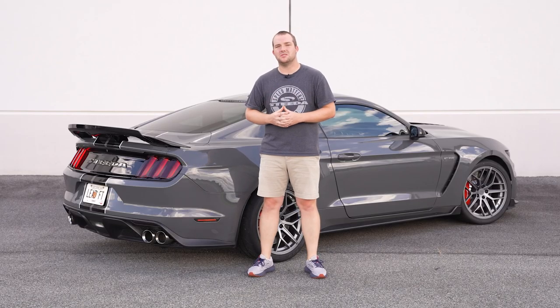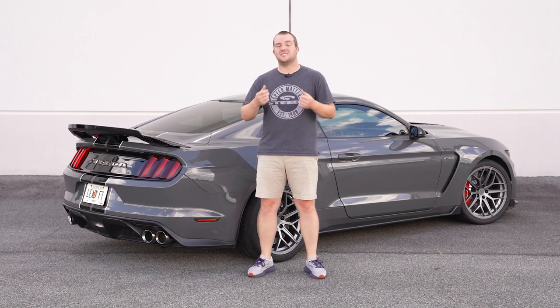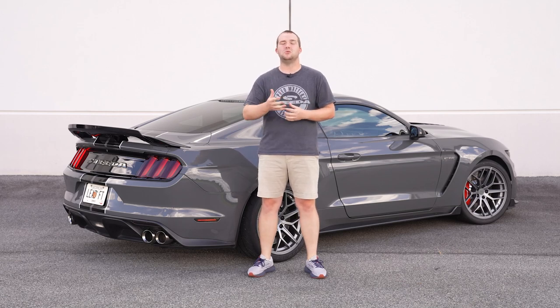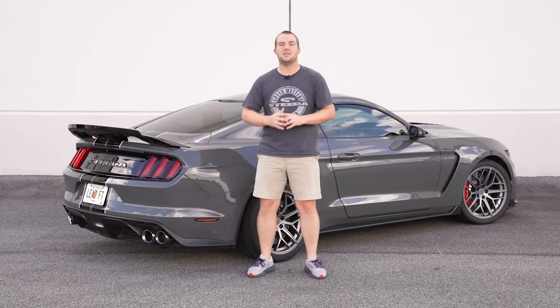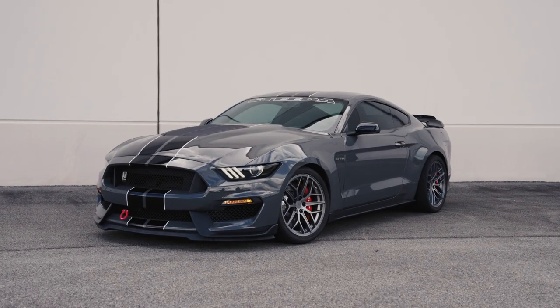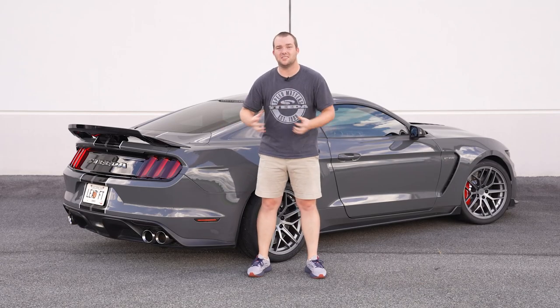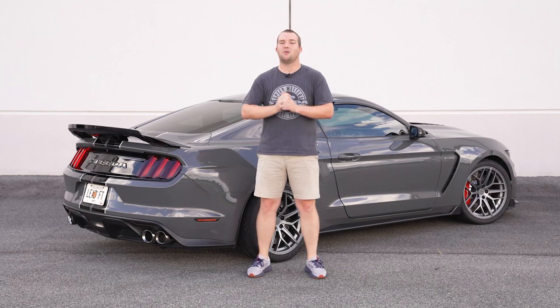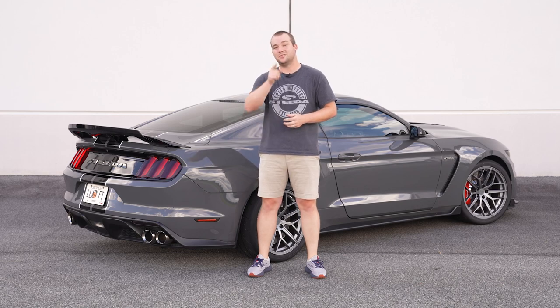All in all, the installation really wasn't too bad — it's the removal of the factory spoiler that takes a lot of time. If you take your time and are very careful, get some high-pound fishing line — I used 25 pound — that really gets the job done. Then use some Goo Gone or Goof Off to get rid of all of that residue. If you are drilling and don't have a spoiler from the factory, take your time, use the template — it has everything you need. Measure twice, three times, and drill once. Comment below and let us know how you think this wing looks on the GT350, or if there are any other S550 parts, installations, or Ford installations you want to see. Hit us up at steeda.com for all the Mustang and Ford parts you could possibly need. Hit that like and subscribe button, the notification bell, and don't forget the most important thing — speed matters.